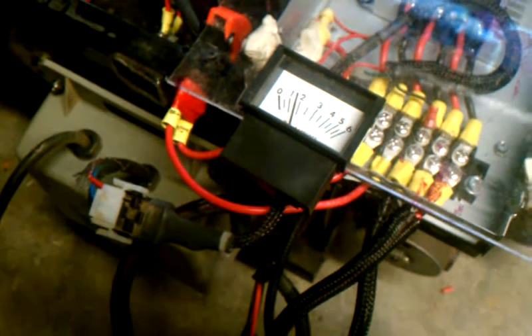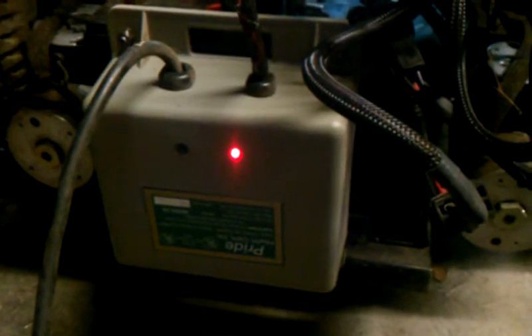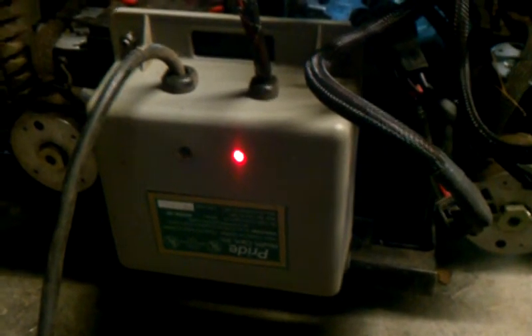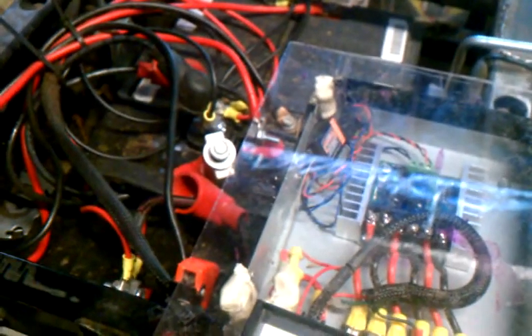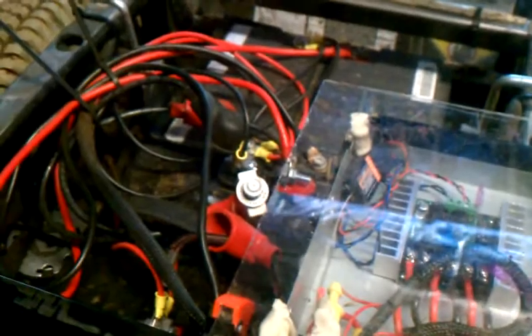This is the newest and most inevitable addition to the RC lawn mower. Anything that runs on batteries, you gotta charge it. I took the wheelchair charger that came with the wheelchair and looked it up online, but the sticker on it told me more. This charger is good for 200 amp hours of batteries, and between those four U1 batteries, I've probably got 200 or less — so it works out to be a good charger. Now I don't have to go buy one.